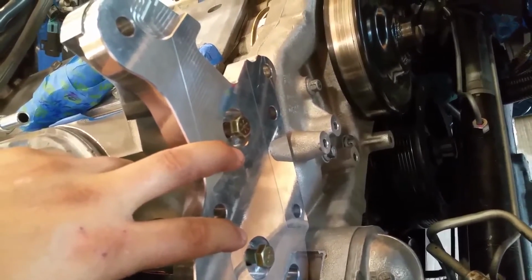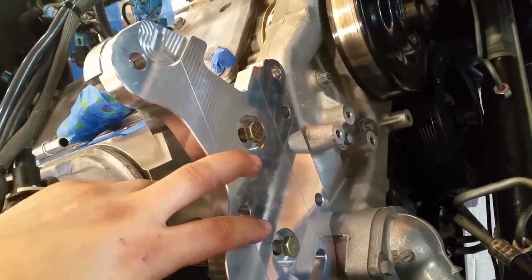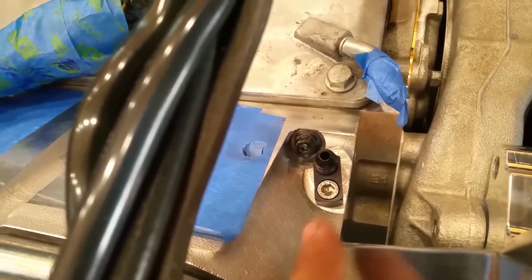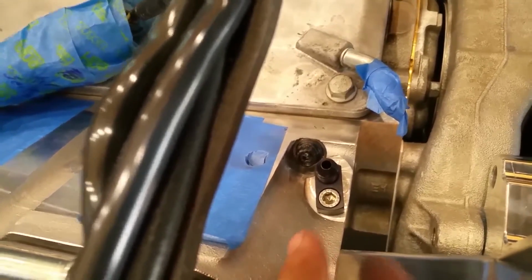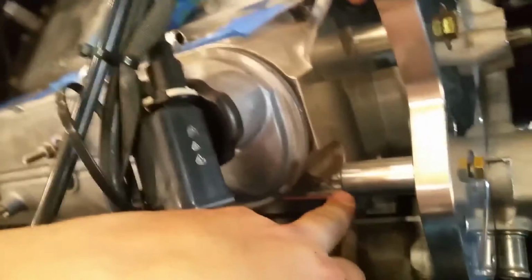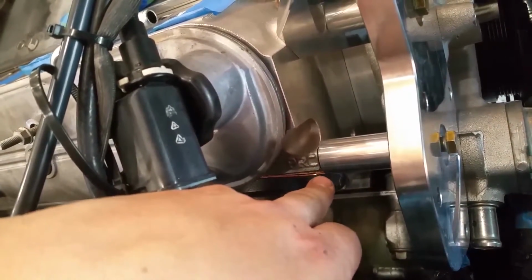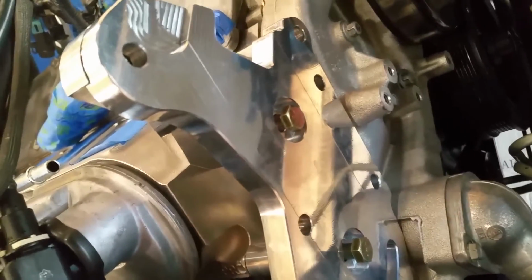Now, the bolts could either be too long, or if you guys remember in an earlier video when I was doing these steam vent kits, the bolt hole is deep enough for the screws that come, but the threading only goes like halfway down the bolt hole. So I pulled out the bolts before and it's the same thing. The bolt holes are deep enough, but they were only threaded about halfway down. So do I cut these bolts, go buy shorter bolts?